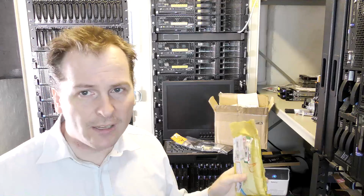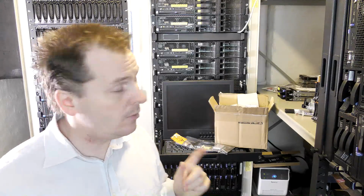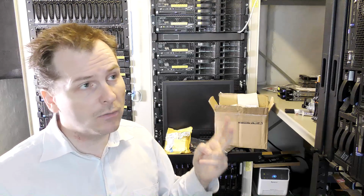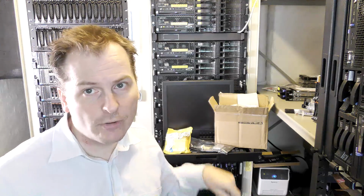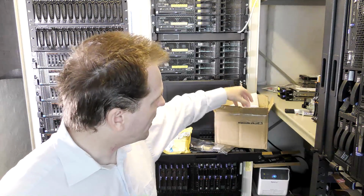But it's not just putting in a couple of CPUs, because this server only has one CPU right now, so there was missing some stuff. There were missing 2 fan blowers. When you put in 2 CPUs, you need all the fan blowers in there. When you order a server with just one CPU, they don't put in all the fan blowers because they are not needed, and you don't really want to have a lot of fan blowers blowing that you don't need, because it's just wasted money, power out the window. So you need a couple of fans, and you need a heatsink for that server. It doesn't just take any heatsink, it needs the right heatsink for it to work. So I got that too.